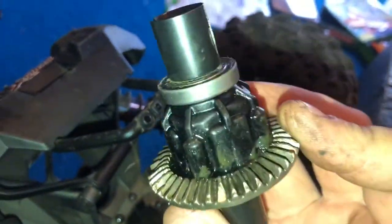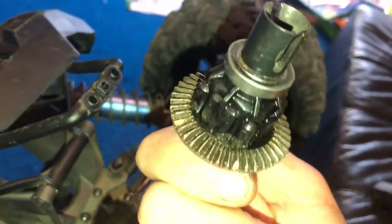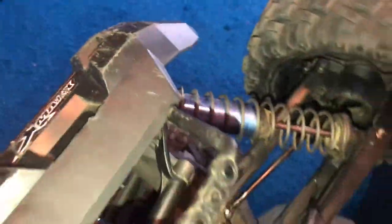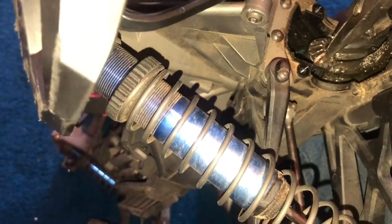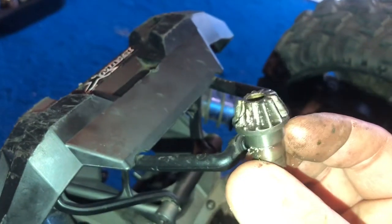Mine — you'll see there are some broken teeth. Not so many on the actual gear, just one here, another one there. But the pinion — you just pull the pinion out, it just pops out of the drive shaft, so it should come off relatively easy. Now this one seems to be the weak link, because you see how broken this one is — quite a few teeth missing.